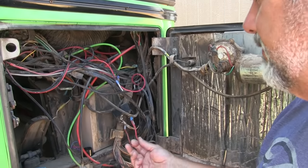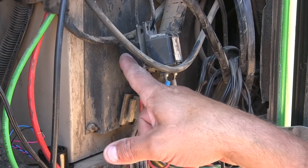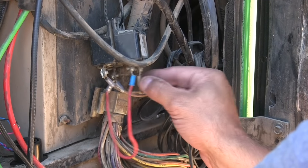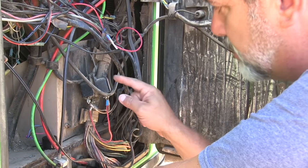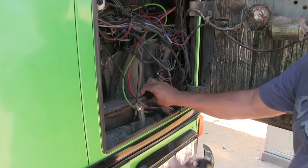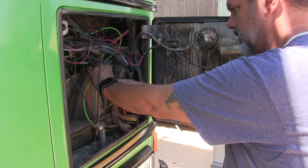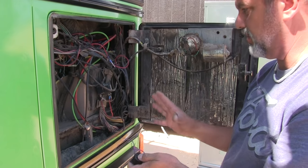We have one last part on our air brake system, which is the pressure protector valve. These things right here are our buzzers — positive comes in right here, goes to this buzzer and this buzzer as the positive link. That tells me these things are switched on by grounding them, which completes the circuit. So these are the switches to the wires, and this is just powering the thing until it gets a connection to ground. I'm going to mount them to this plate right here and here, then tie in the wires to the appropriate connections.